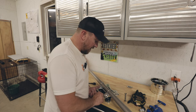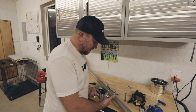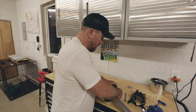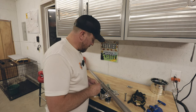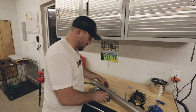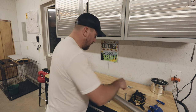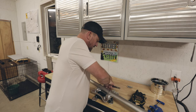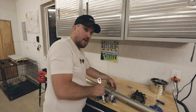Any excessive overhang needs to be on this side because if it's on the other side, it's gonna conflict with some of these bolts and rub as you're rotating the seat around. These will need to be locked down nice and tight before you move on to the next step. I'm gonna bring these bolts out all the way to the edge so I can make sure that everything is centered on the swivel and on the adapter. The good part about being a round bar like this is that you can adjust the tilt of the seat with the clamps that are actually on the boat.